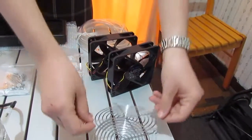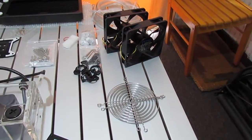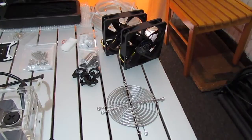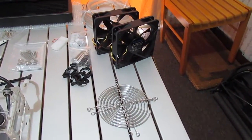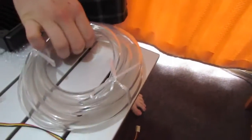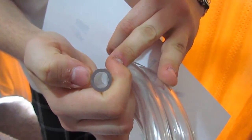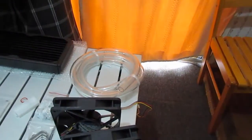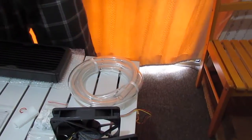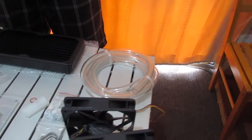The grills protect your fingers from the fans. The fans are 1700 RPM 120mm fans as mentioned. We also have two meters of clear seven-and-sixteenths inch tubing. You can see how thick it is compared to a fingernail — it's pretty good. Two meters should be plenty of length if you're only cooling your CPU or one of your graphics cards.